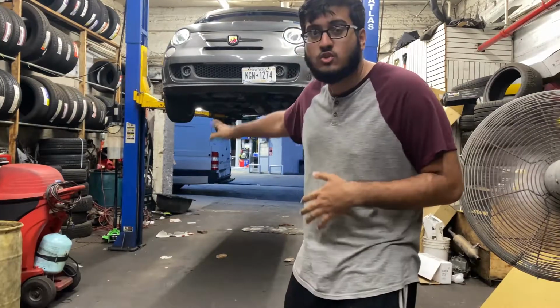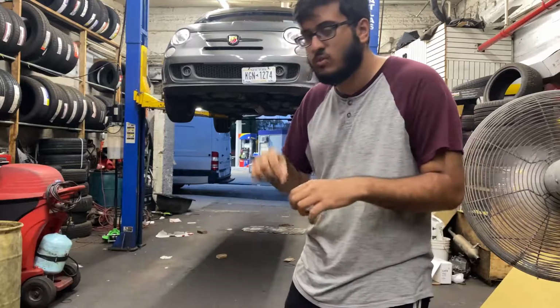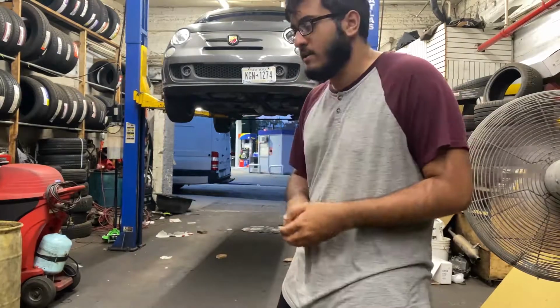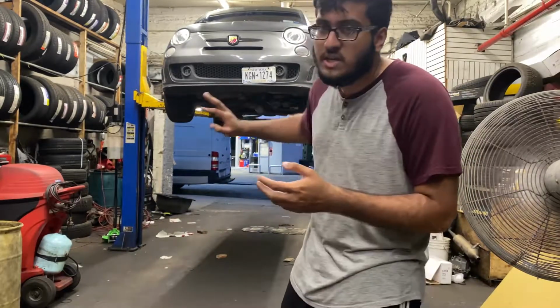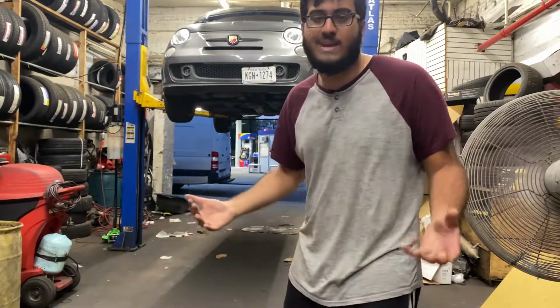One thing I forgot to mention about getting the new exhaust is that my stock exhaust right now, besides the fact that the downpipe does not fit, has a lot of cracks. Some of the hangers that come off the exhaust are getting kind of deteriorated. So whenever I'm driving, if I hit even the smallest bump, or even when I start accelerating, the exhaust, of course, moves. And I hear a lot of squeaking. Throughout the entire exhaust, there's cracks kind of getting messed up here and there.